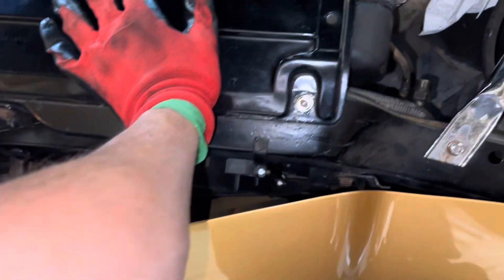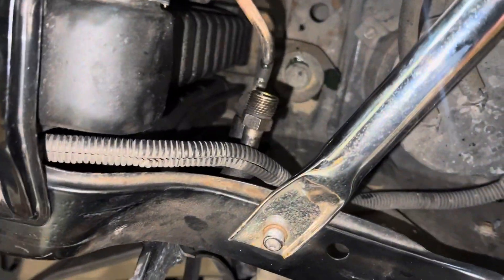That is like nothing — very little is coming through your condenser. I think there is piston ring material inside that condenser from a previous compressor failure.